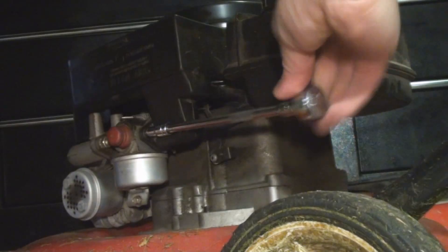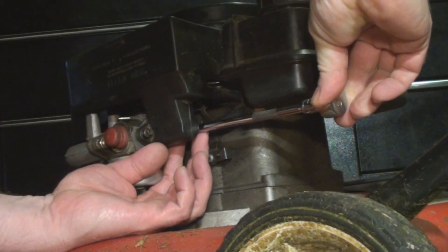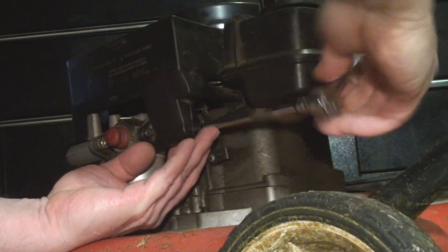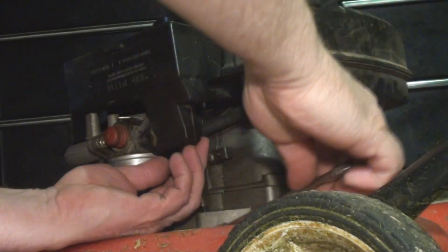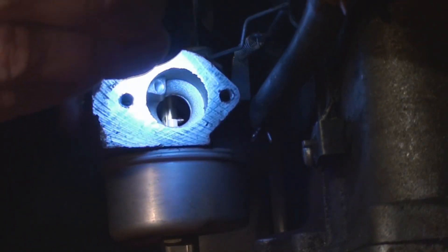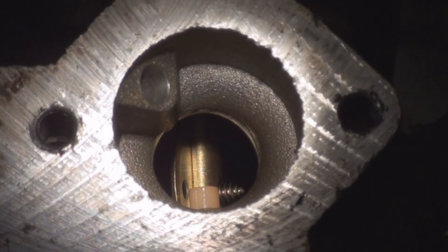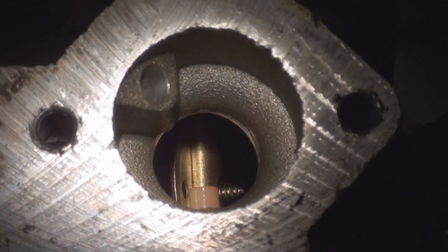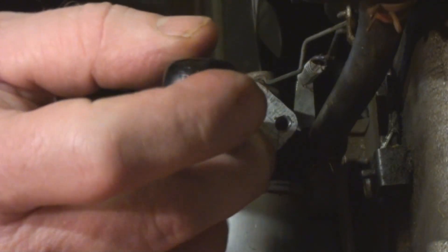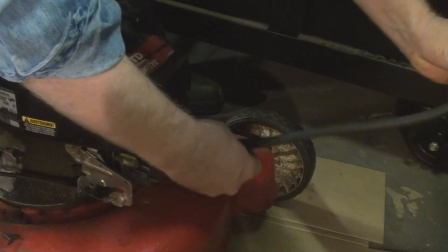Just push on this spot right here and that releases the lid. Remove these two screws — there's another one in behind here, which is why you need the long extension on your socket. Once that comes out it just falls away. You can see the throttle plate in there. The procedure is to put a screwdriver in this hole to block it open — whatever you use, make sure it can't fall in and won't break apart. Put the screwdriver down past the throttle plate and make sure it's blocked open before pulling on the cord.